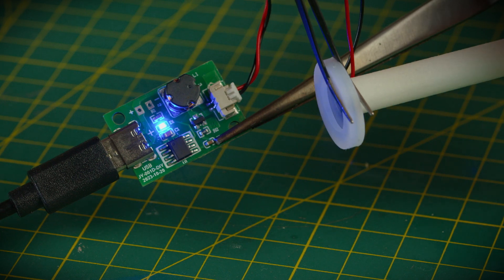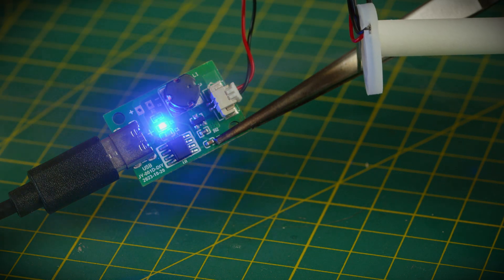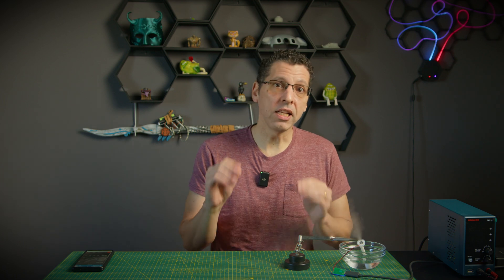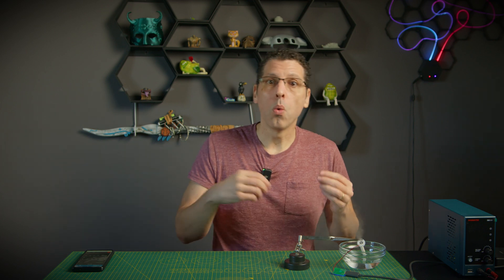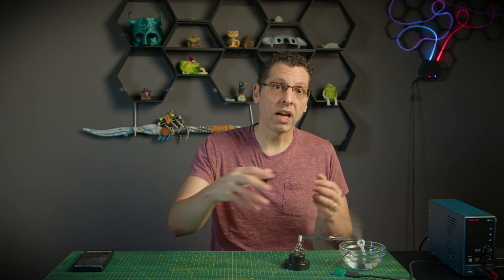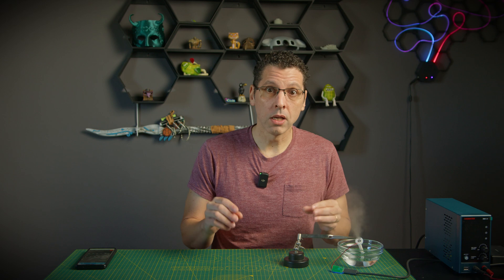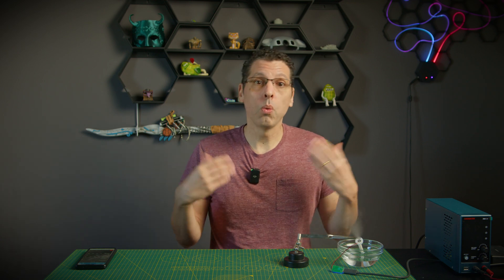To work, just connect the power to the USB and touch the wet stick on the transducer — that is the right side to work well. But how does this work? Interestingly, the word 'piezo' originates from Greek 'piezein', which means push or squeeze. The piezoelectric crystal inside the transducer works like a linear electric motor — it moves in line. When the crystal receives electricity, it vibrates very fast and throws micro droplets of water in the air, which, being very small, evaporate immediately. And it vibrates beyond the sound we can hear, which is why we can't hear the vibration.